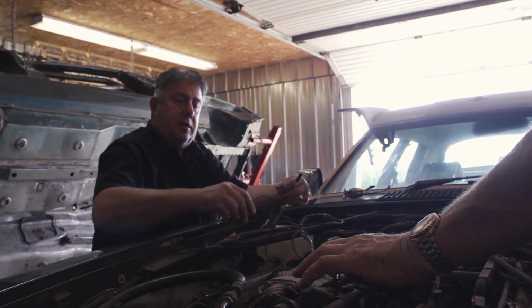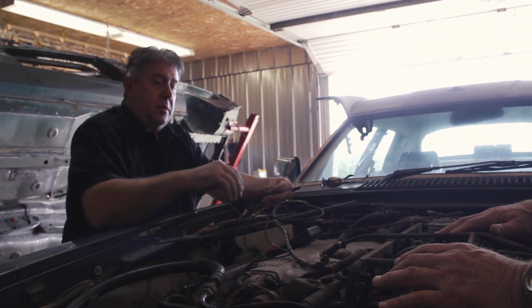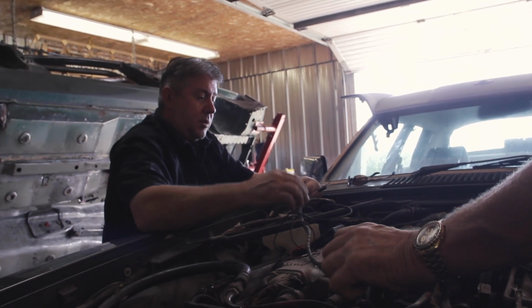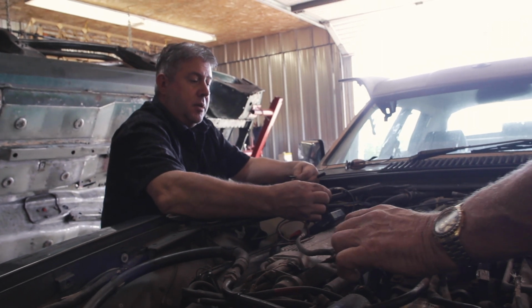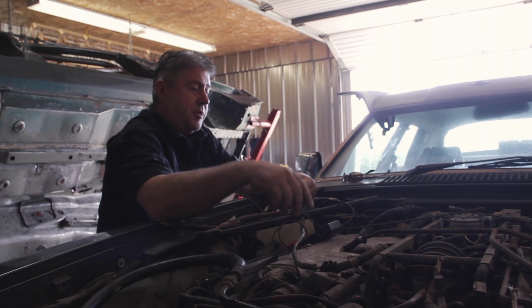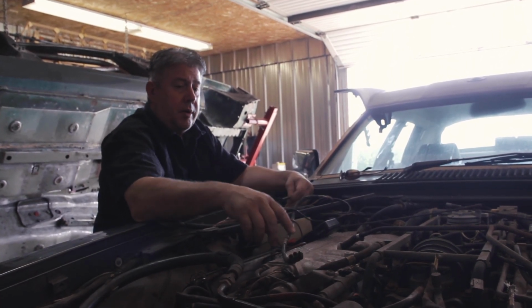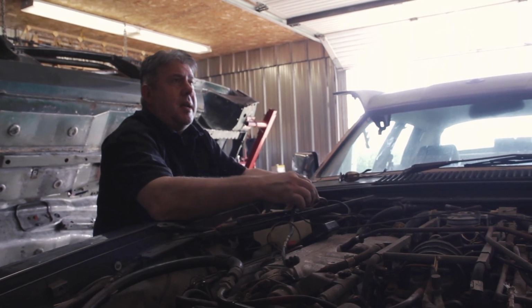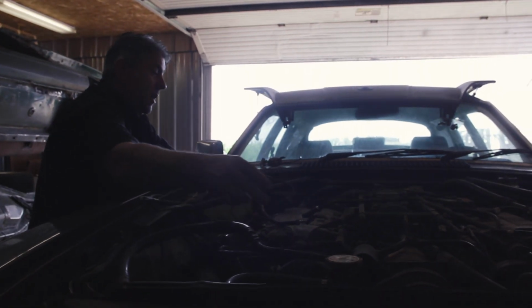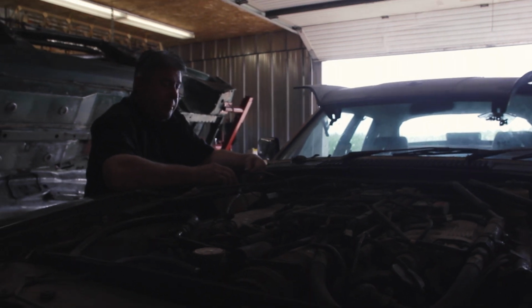It starts here, and it comes through the middle of this connector right here. Okay, so that's yellow and black there. No, well, I think the wires have just faded. And there might be a bad spot in here, because when I first started checking it, you can see where this casing's opened up. When I first started checking it, it was open from here to here, so we might have a bad wire. Now that I've moved it around, I have continuity all the way out to the end. But when I first checked it out here, there was nothing.